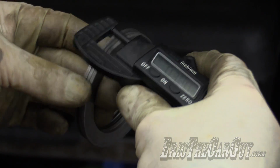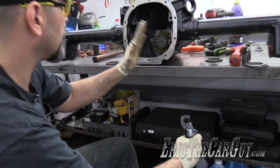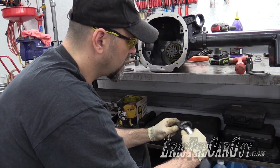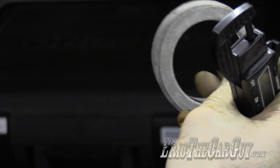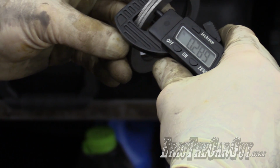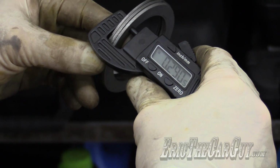So this is 295, so that's still a bit much, because we're trying to take 20 thousandths from here and add it over to here. And if we start out at 306, we need to be down in the 280s. And this seems 297. That seems like a bit high. We're not really taking all that much away. We almost need to take one more of these, which I think is not going to be quite enough. Well, 288, 289. That's close.